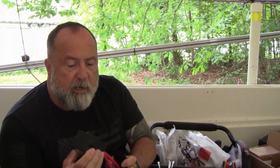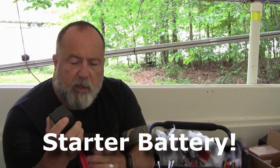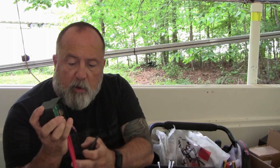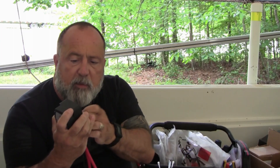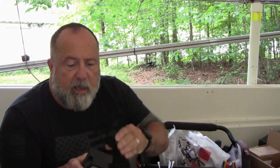I'm going to be using a battery relay. I've pre-terminated these — the one with the red mark is the charging battery, so that's the one that gets priority. It's got a black ground which provides ground for the electronics. I've marked the starting battery with red tape. I'm going to go ahead and mount this — I did a loop because I used every last bit of it — and then cut it to length as I put it in, then terminate the cables.